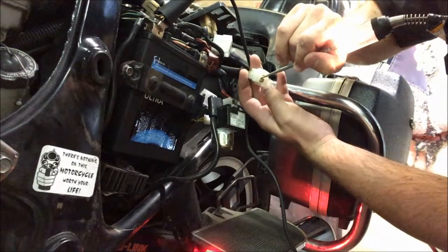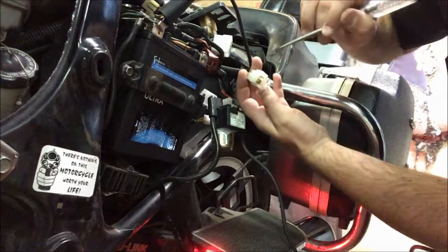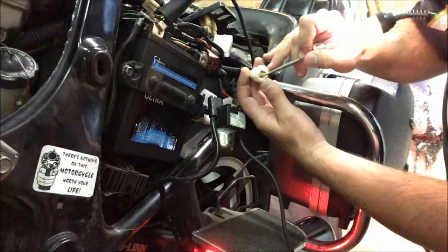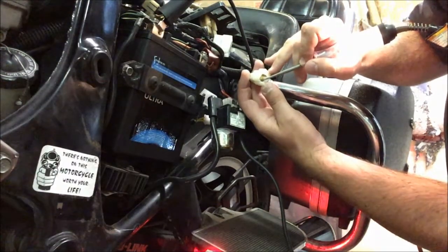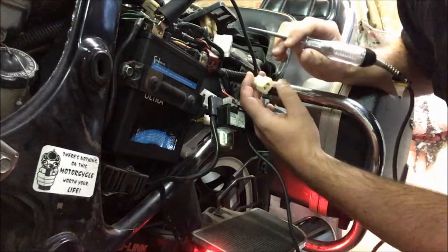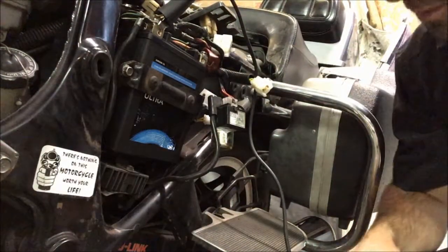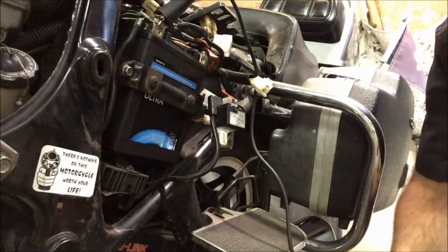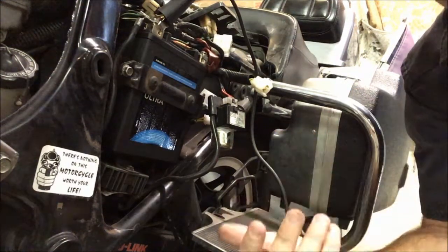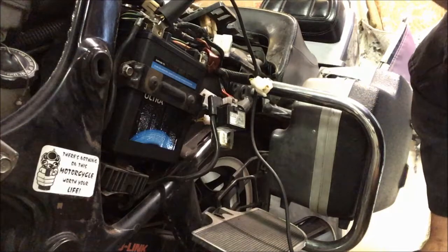There we have what shouldn't be — a glowing light. That's indicating that my stator has an insulation breakdown. I go through all these different leads and sure enough my stator is junk essentially. That stator is reverting power to ground because the insulation has broken down.